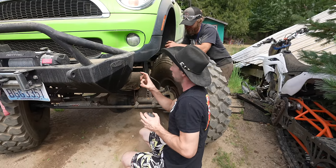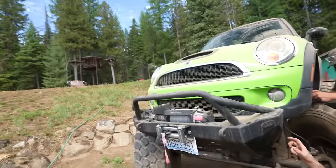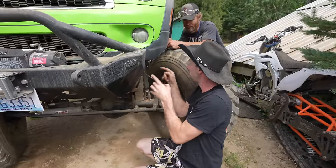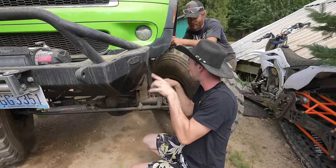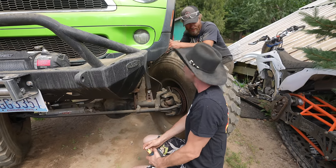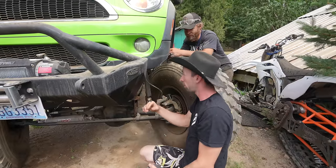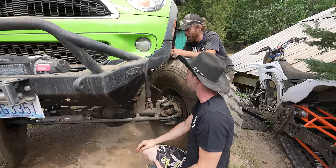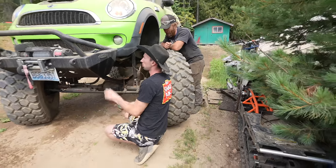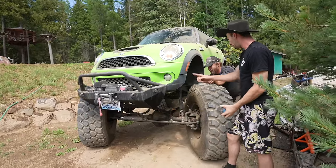It also gives you the softest wheel rate you can get with a shackle hanger, spring hanger and leaf spring combination here. It makes your springs as soft as they can be without removing leaves, and without it camming over and getting locked up, because right now you have zero compression in your suspension. None, it's bound. Because it can't change length, and it needs to change length to compress. So front needs to be 8.5, and it's the same formula for the back.